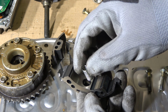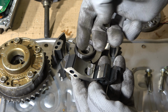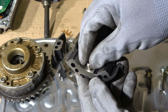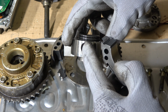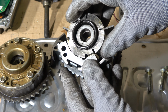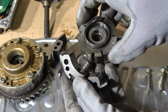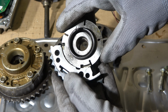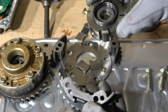these parts, like in that part, this is this locking pin. This goes in here in that way, and in that area we can see this locking hole, and these parts lock like in here. Now they are in locking position, and then when this is released, these parts can move freely in here. And this is this Vanos sprocket's idea.